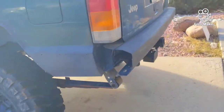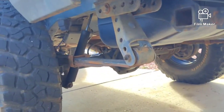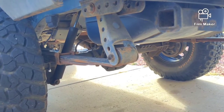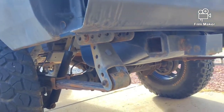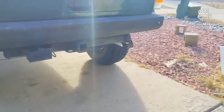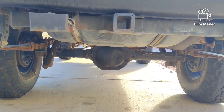And in the back, I can't tell if these are a bastard pack or aftermarket springs, but we have a Dr. Z shackle relocation kit with what I believe to be Chevy drop shackles, which is a common mod, but I want to go to shorter shackles and different springs later on. Got a trailer hitch for a recovery point. Then we have an Aussie Locker in the 8 1/4 rear, which is a 29 spline.